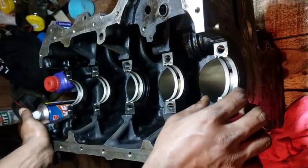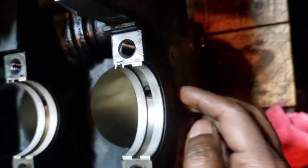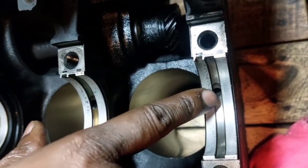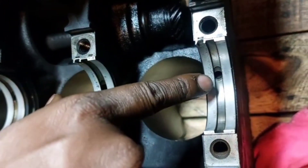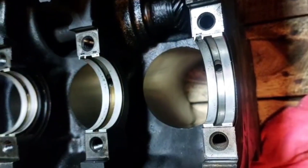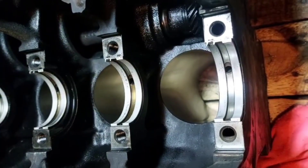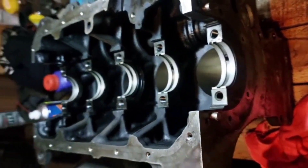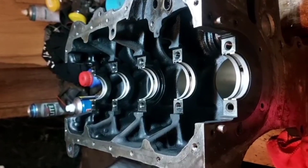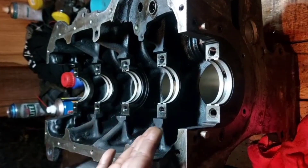When you get your bearings, you're going to have a bearing that has a hole in the center. On the engine block you're going to see oil ports — one, two, three, four, five — so this half of the bearing with the hole goes there so oil flows into the crankshaft. The other half on the cap is a plain bearing. The main bearings usually don't give much of an issue; if they were worn out you'd see blue score marks. But I don't advise anyone else to do this — it's best to purchase brand new main bearings.